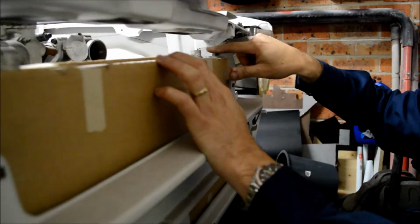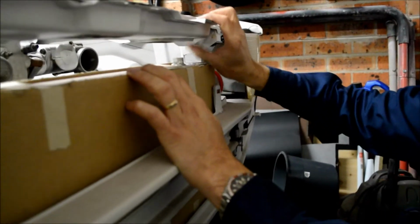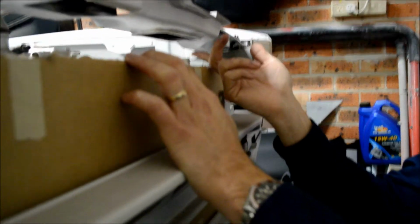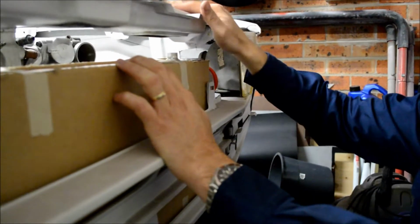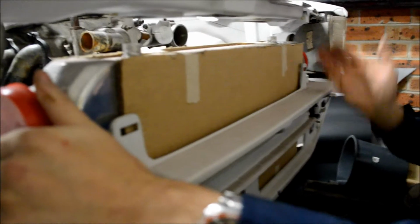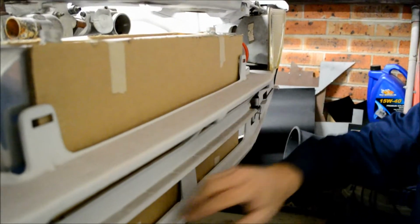That just sort of comes off here, angles up, and then sits flat again, and mounts to the radiator support here. So we'll just have a riv nut that we'll put into there, and a bolt or a screw, whatever, and then one into here, and that'll be plenty. And it'll stop the intercooler from moving back and forth, and stop it wanting to go up as well. So it won't allow it to actually move up at all. So it keeps it located in the bottom mounts that we made. Okay, so we'll get started on them now.